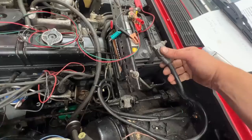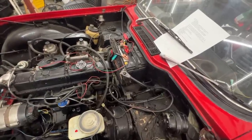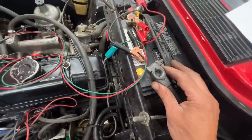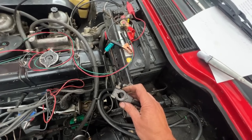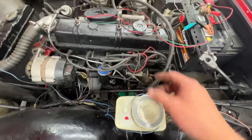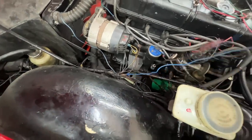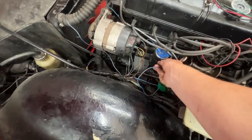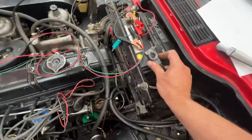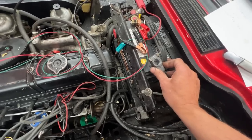There was a spark for a second and then there wasn't. It's almost like there is a condenser somewhere, but here everything is disconnected. The coil is disconnected, the electronic ignition is disconnected — we're gonna deal with that later. This is the ignition wire; even though it needs to be white, somebody turned it into a blue, and that was connected to the positive of the coil. But look at that — it sparked like crazy initially and then not anymore. We have to investigate that.